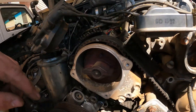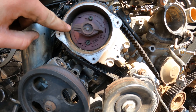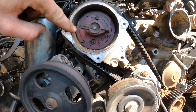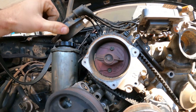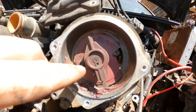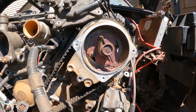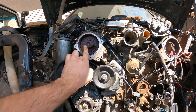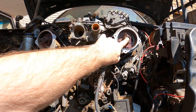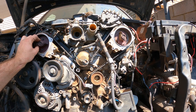You guys won't believe this. Let me show you — on the one side we've got our rotor, looks a little bit cracked. This has definitely seen much better days. And as you guys can see inside the cap as well — look at this side, look at all this junk just lying here, broken. The timing looks to be set on, but I can promise you that this is probably messing me up. So I'm going to look for new ones and replace them while I'm at it. There's no sense in even trying to keep those in.